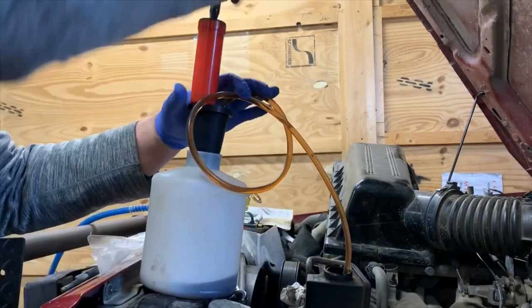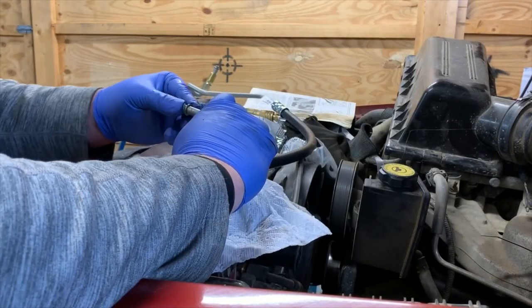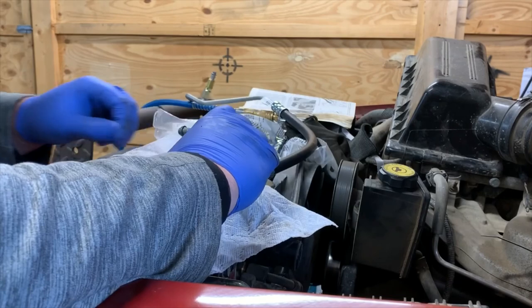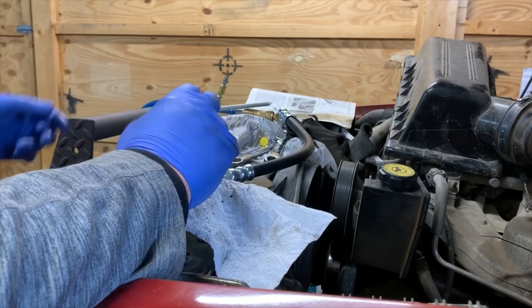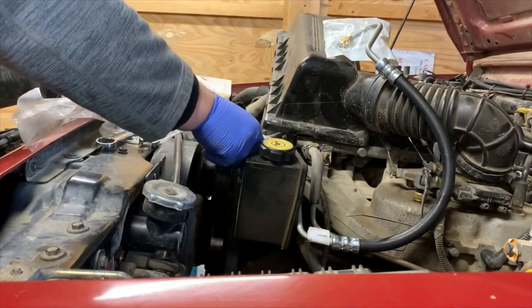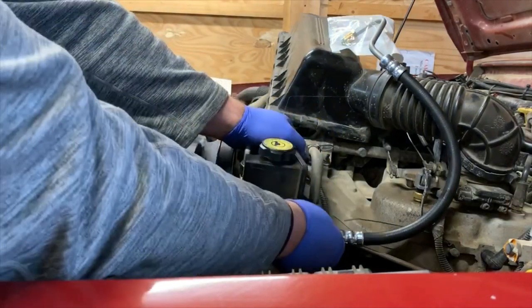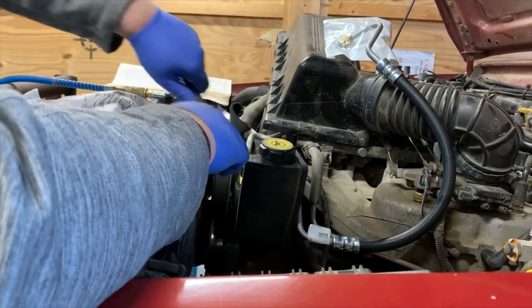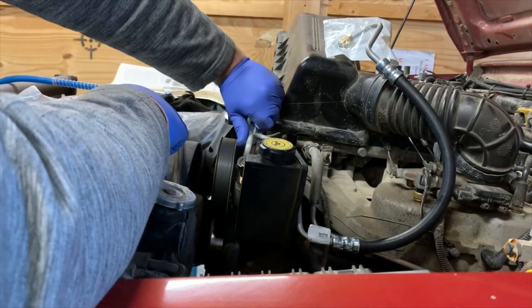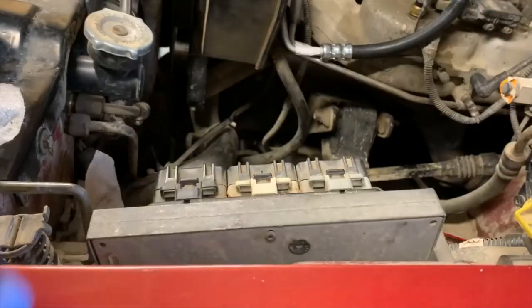It's pretty hard to keep the hose down in there — not so flexible anymore. Now, the instructions say to install the new o-rings and lube them up with some power steering fluid — use the fresh clean stuff, because that's the intention. Get them aligned just right so they tighten properly and don't cross-thread, because if you cross-thread this fitting and don't get it properly seated in its hole, that's pretty much the end of your day. A 5/8" flare wrench seems to fit just fine.